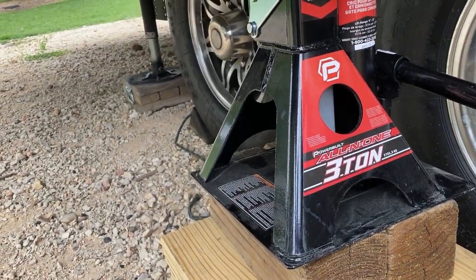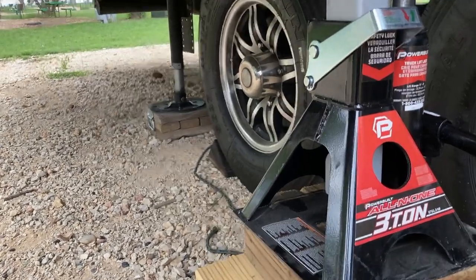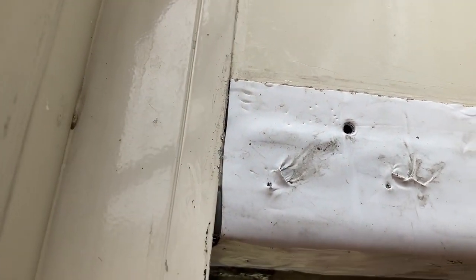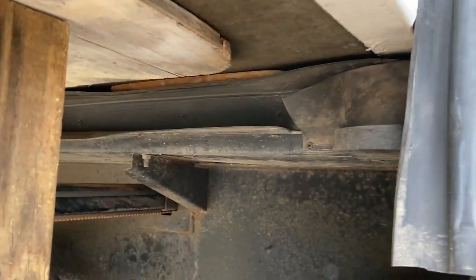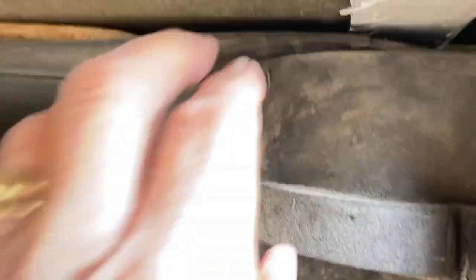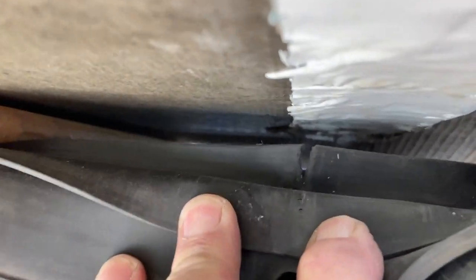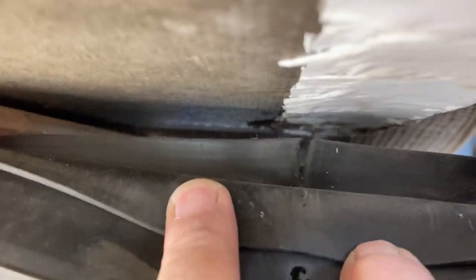We're cutting it off at 44 inches — it's a little long, but we can always trim it. We're going to test fit it before we do anything else. We're going to come right here to the edge; I don't want to pry this piece out. So we're going to bring it right to the edge and then put sealant in there, which you can see up in here to the inside of the coach. That ski has to fit right along where we've got all that EternaBond, and then we'll put butyl tape between the ski and the EternaBond.